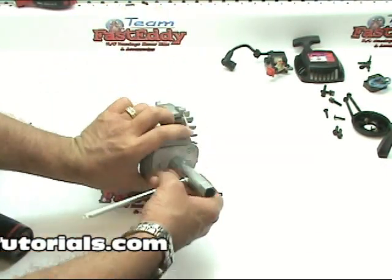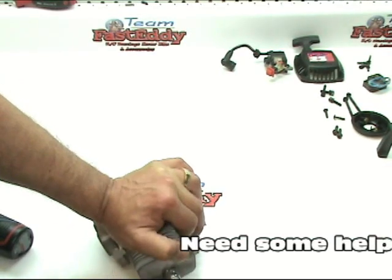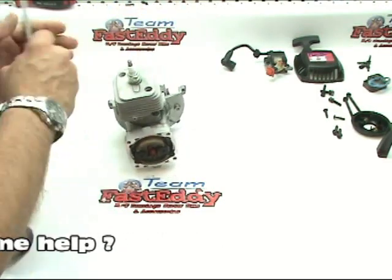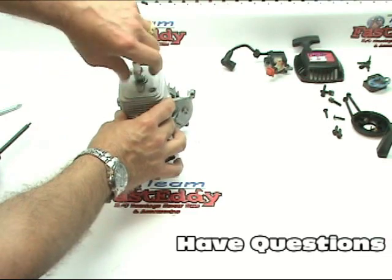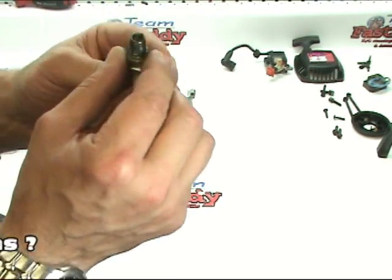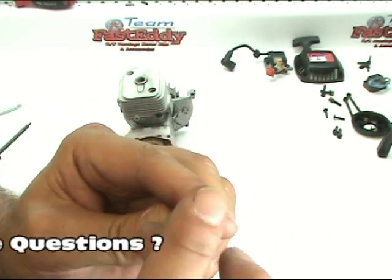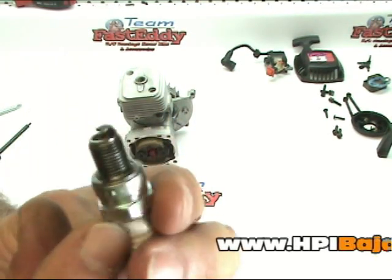Sometimes they're tight — maybe it's not quite so straightforward today. I'm going to get some leverage on the side of the bench here. There we go. Go ahead and remove the spark plug. Take a look at your spark plug — a lot of times that will tell a lot of stories. We're going to take a look at this one and it's hard to see, but it is a little bit on the dark side, not loaded up with any oil, so we're doing okay on that.